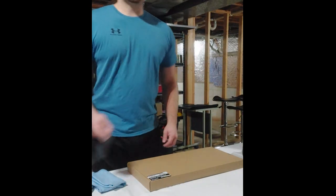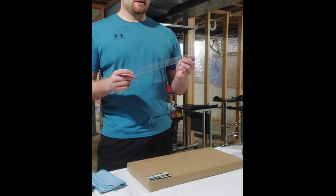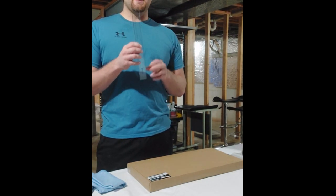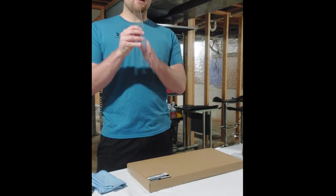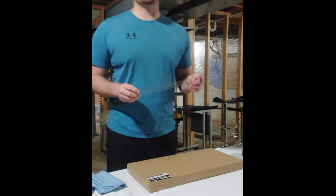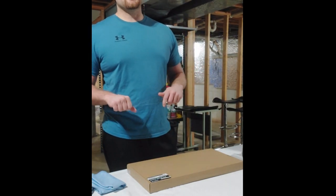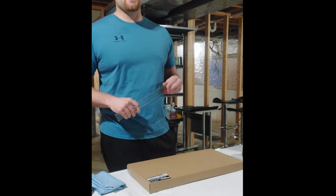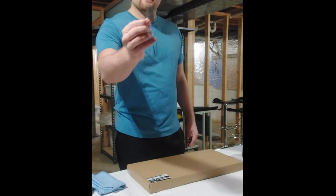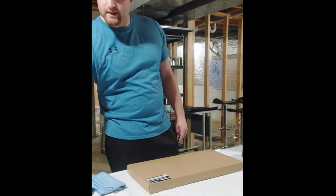Next, you're going to want some type of straight edge. I use a clear ruler. This works really, really well, and it's nice for if you can't quite finish a line on the glass. You can cut right along this. And then also, you're going to want to check if the glass you're tinting is hardened or safety glass, because if it is, you can cut on it as long as you're using the right type of blade. And then you're going to want a flat razor, just like so. This is going to be for cleaning the glass.